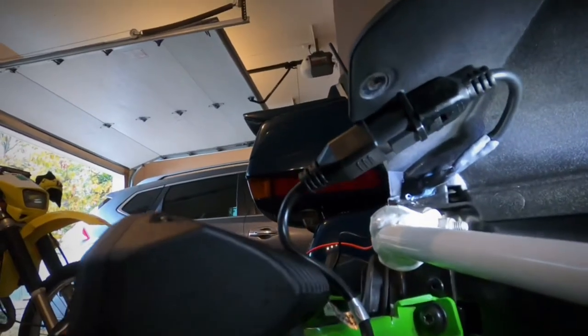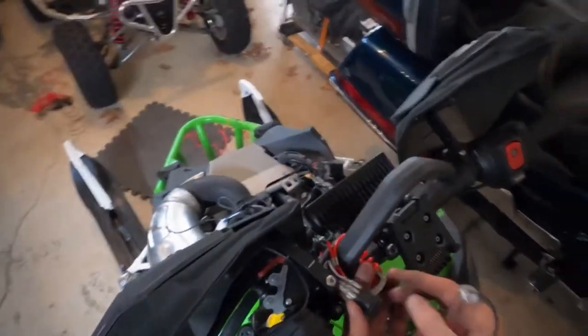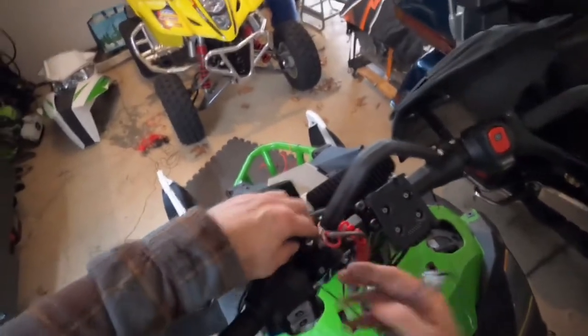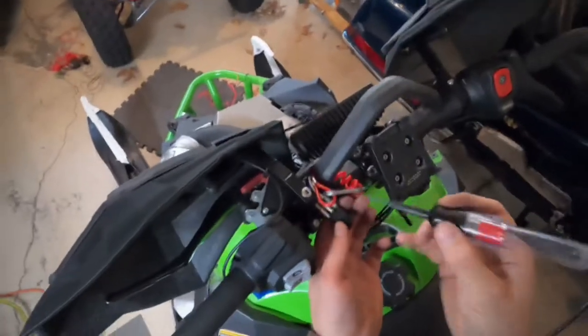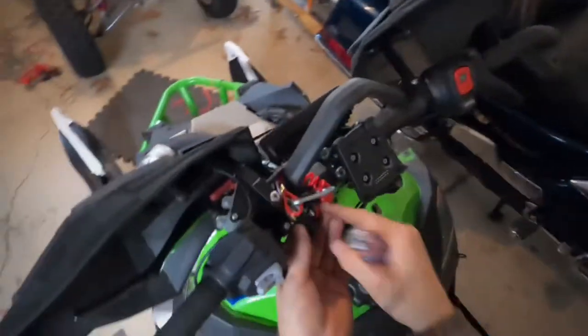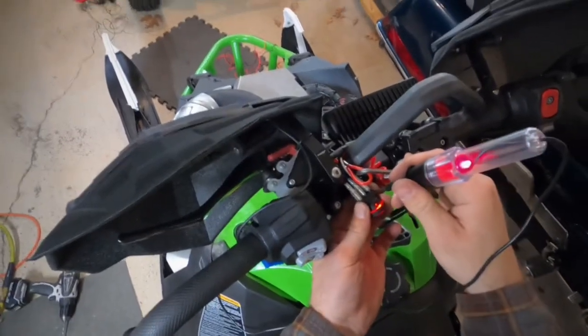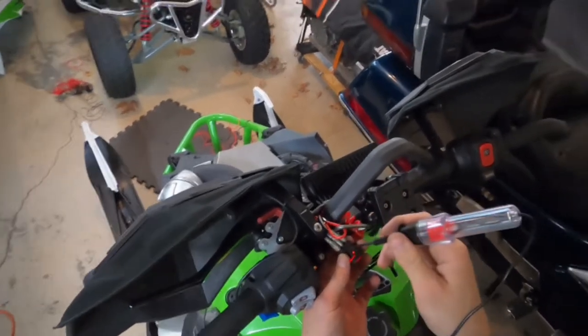So there you have it — that's how I got my wiring in there. I'm going to hook up my switch right in here. This switch goes to my light bar on my handlebars, and I want it so when that goes on, these lights come on — all one system. Get yourself a light tester, ground it on the machine to find your constant power. Turn your switch on, find the power when the switch is on — that's the one you want to splice into. The other one is your ground.